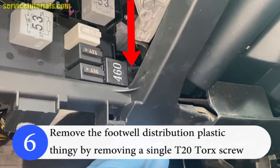If you bought a new set of heater core clamp and gasket, you can take the old ones out. To disconnect it from the pipes, one person must go outside and pull the two pipes from the outside, and another one will pull from the inside. You have to be careful because about 400 or 500 ml of coolant may flow, so you'll need a container in which to collect it.